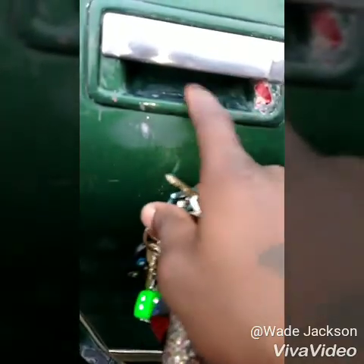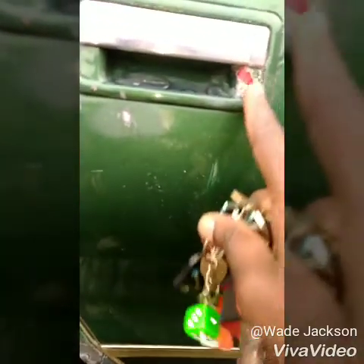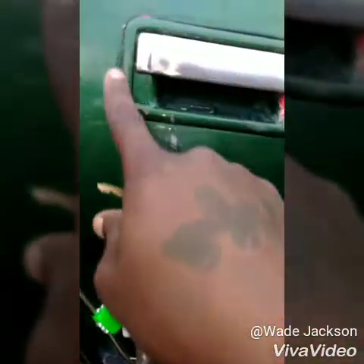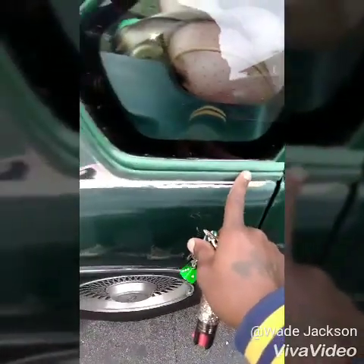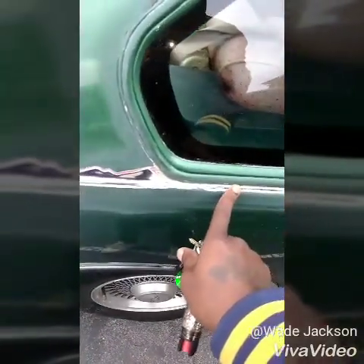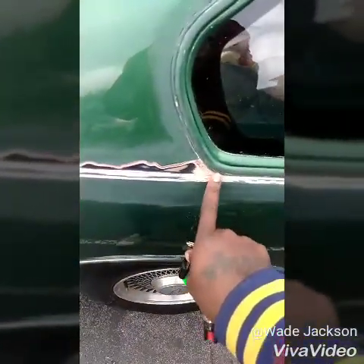Right here I got a mess. I'll probably be picking this paint off, resanding it. I'm probably thinking about doing this whole thing gold on the door. Oh my gosh. This is a big one right here — paint bubble. Cracked it up and then I sanded it with the 400 grit, making it smooth.